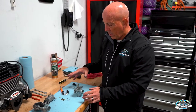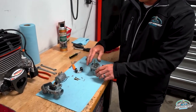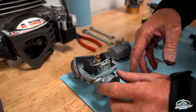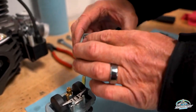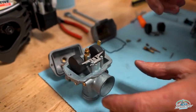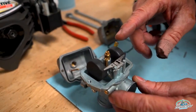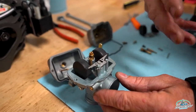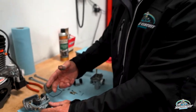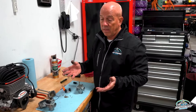I wanted to show you the difference between the carburetor from a cart that had been sitting for a while versus one that's completely reassembled and very clean. You'll notice how nice and clean the components are, the floats bounce up and down very nicely, and the gasket adheres very well to the cap. All the components work as they should — this is what the carb should look like on a day-to-day basis. The fuel flows through here and many small orifices, so you want it to be perfectly clean. If you're racing and serious about this, you want your carburetor in tune — especially with today's modern ethanol pump gas.